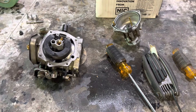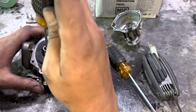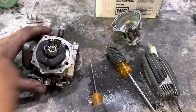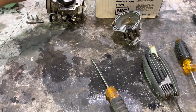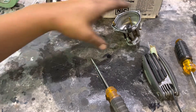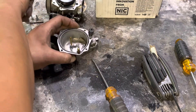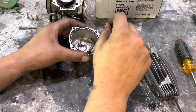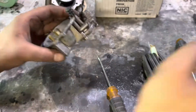The body of the carb is good. Looking at this pilot through the light, it looks substantially bigger now — so that's good. A little crap in there; I really should put a fuel filter on that bike but I haven't done it yet. Still got the original factory hose clamp on the petcock. So the body of the carb is done — don't forget your little rubber stopper for the idle circuit. Now since we have this apart, if I push down on this it should give me a little fuel. Nice strong stream out of the accelerator pump like it's supposed to be.